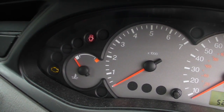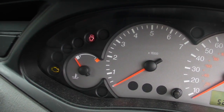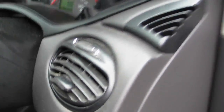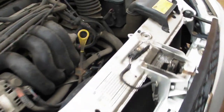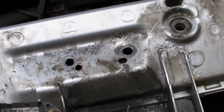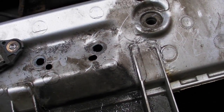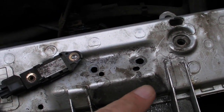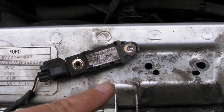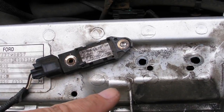I've also pulled the code in the scan tool, which says the front crash sensor. But if you've not got a scan tool, four two will show you about the crash sensor inside. That's it there — it lies underneath, under the plastic cover. So it's just two bolts. This is the front crash sensor that we're going to replace to get rid of that fault code four two.